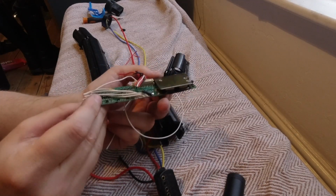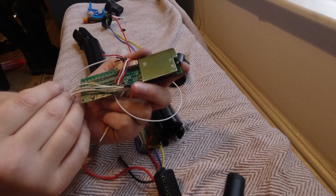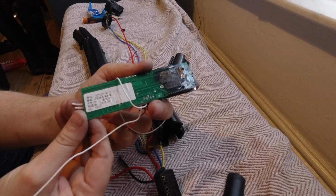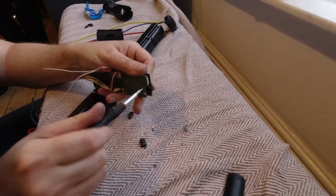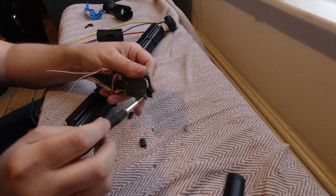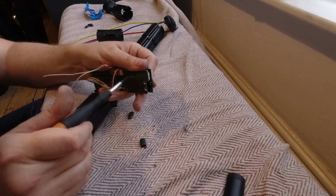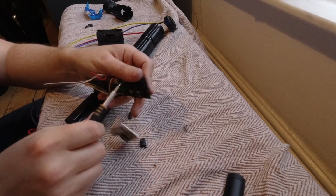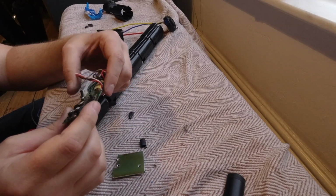For now, as you can see, that's the only heatsink there is on top, just right there. It's a terrible design, and it was all encapsulated inside the handlebars, inside the plastic, which is not heat-proof plastic at all, not even heat-resistant. Hence why it's melted everywhere. And then behind there, as you'll see now, are MOSFETs. Completely and utterly burned MOSFETs.